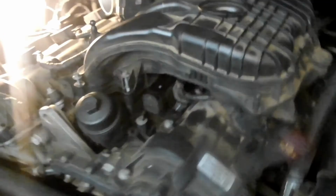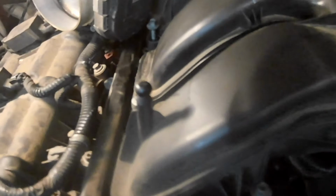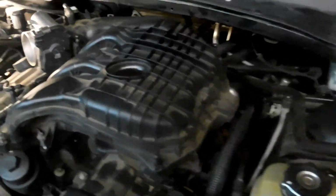Okay. You got a major one back here. It's got three bolts in it. One bolted onto the block, and then the other 2 are bolted down on the back side of the plenum, holding the plenum down. Okay. And then what you got left is the plenum bolts themselves. Okay. Got to bolt them down even.